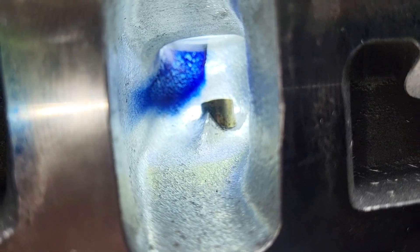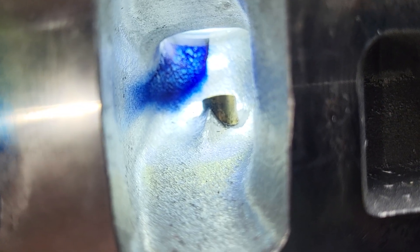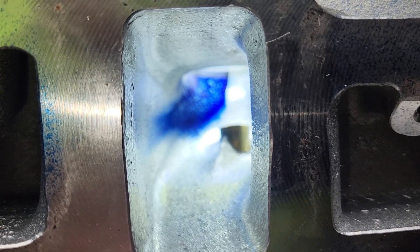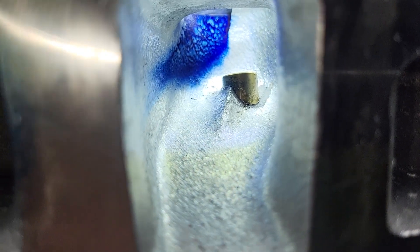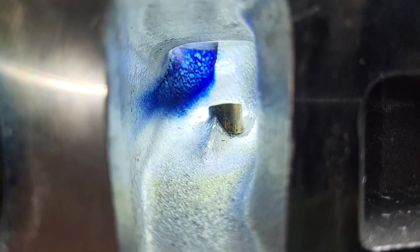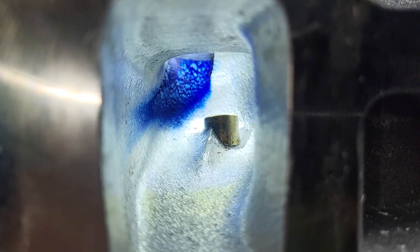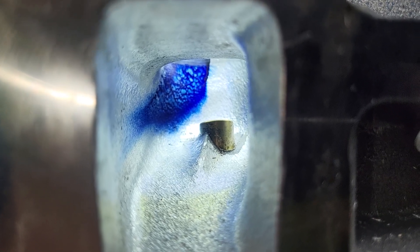In reality, first cut is really just a cleanup. We took a little bit off the pinch, but can't take much off the pinch — it's very thin. Went through around the whole port, took all the lumps and bumps out of it. This is not a heavy casting, so you can't just gouge out big parts of the roof or anything — you'll make a hole. It's quite thin before you do anything to it.